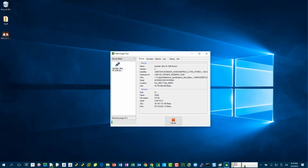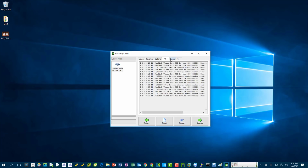Okay, I'm going to go ahead and pause recording until we get to the end here. It takes a while, as we talked about, and USB drives are even slower at writes than they are reads. So of course this took quite a bit longer to write the entire drive. All 32 gig, I believe, is what's transferred. So again, all these Windows tools don't really have awareness of the file system the way ESXi lays things out. So you're better off with the device mode, complete clone of the drive, and it just finished. So I'm done. Let me just do a quick look at the other tabs. Anything there to show you? Okay. Some stuff.